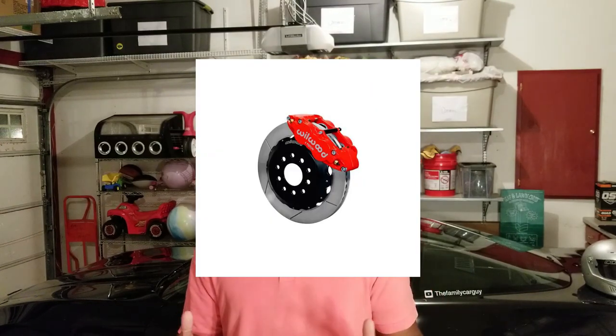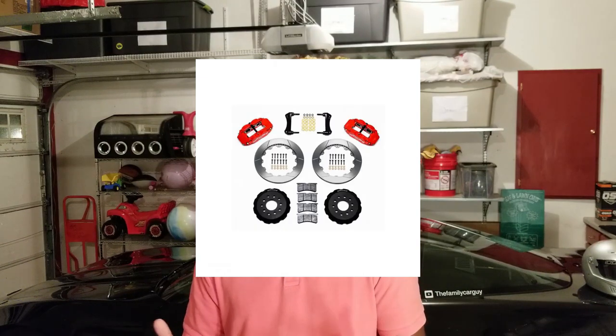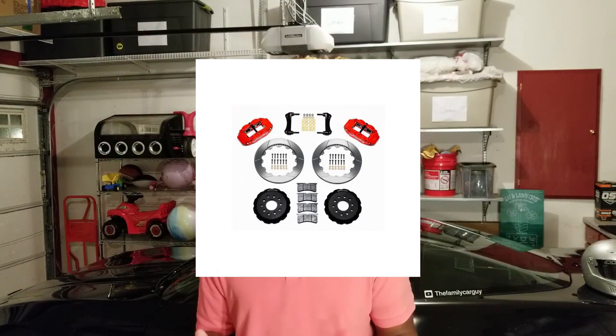Speaking of pads, carbon ceramic is what I'd recommend. If you go full ceramic you get minimal brake dust, but the bite won't be quite as good as a carbon-ceramic mix. I have Power Stop drilled-and-slotted rotors on my car — I got a decent deal off Zip Corvette, and I'll put that link in the description. If you have a really high budget, you can go with a Baer or Wilwood brake package at around $3,000, which in some cases equals the purchase price of your C4 — so at that point you're a pretty diehard track enthusiast.